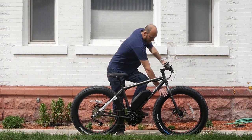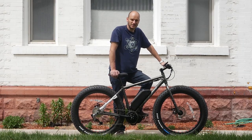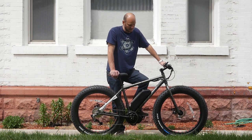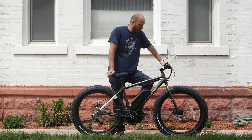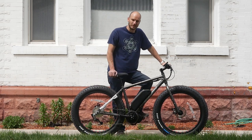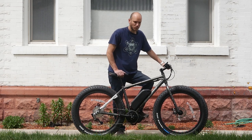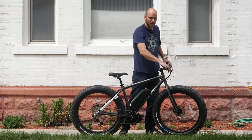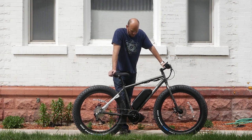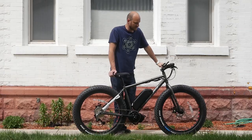You can see this bike has pretty full tires — running about 25 PSI. The top speed on this was probably the fastest fat bike I've ever tested. It is a little windy here so a gust at my back could have helped slightly. Hill climbing was right on par. If you need more hill climbing with a fat bike like this, just put a smaller chainring on it or switch out your cassette for a bigger one. I've done one with a 50-tooth in the rear and a 28-tooth up front — on full throttle you're literally just wheelie-ing it. If you need a mountain goat of a climber, put a small chainring on it.